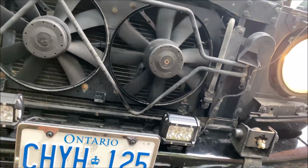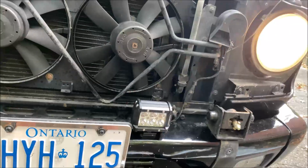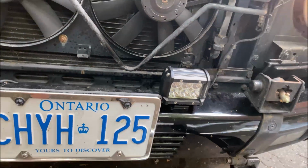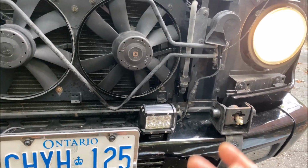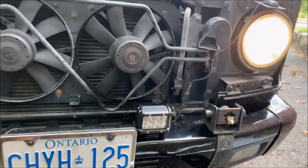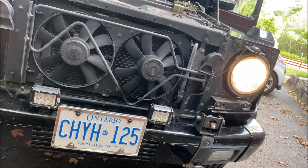And it was merely, like I said, I guess the fan gets a little bit warped over time, and also that with the paint, you know, semi-corroding off the back. Those are galvanized, so not a lot of corrosion on there, but the paint did lift off after years, and just enough it swelled underneath to hold the fan, and then the fan arced when the motor tried to turn it, and now everything's working fine.